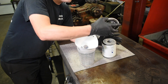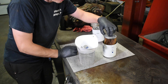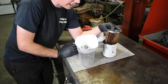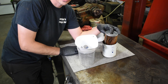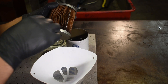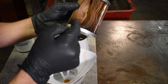There's really no magic to them. It's got an aluminum top and then just a regular, basically paper filter inside. I did cut it with a cut-off wheel so we are going to have a couple of small pieces of metal in here, but this is still going to give you a pretty good idea of what we've got going on. Even just looking in between the pleats of this filter you can see there's quite a bit of sediment built up.